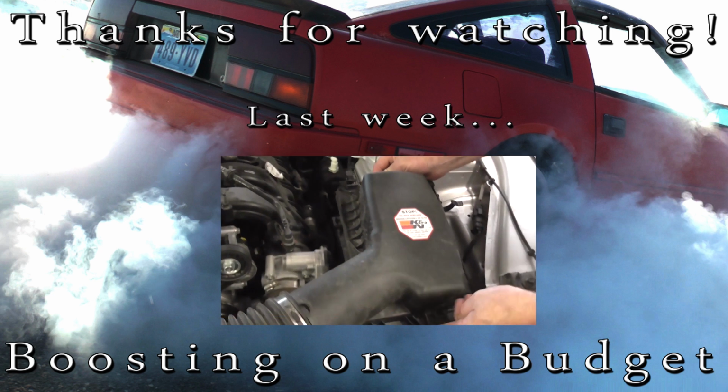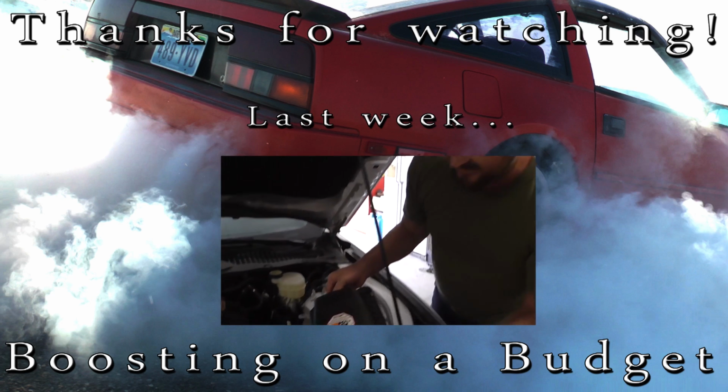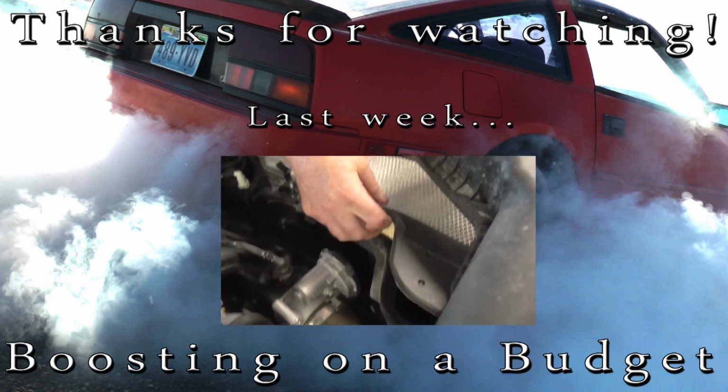You pull two clips, one and two. Then you kind of lift and see these little ridges here. You kind of lift and push back, and lift this little guy out like that. I'll set it here for now. Voila, look at that. Here's the stock paper air filter. We'll pull it out.